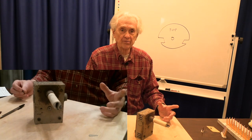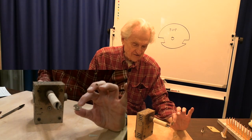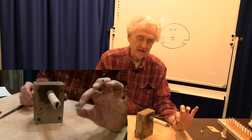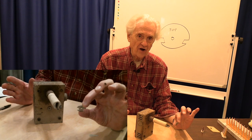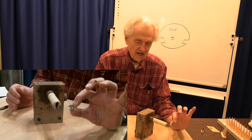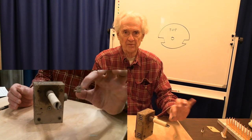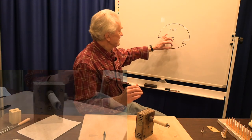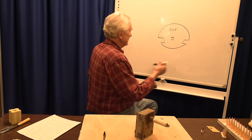Or I can also use a gauge, which is supplied when you buy a new electric kiln — it comes with a little gauge that looks like this. In most cases when the kiln sitter is shipped, this gauge comes shipped on the kiln sitter. This is only for manual kilns; kiln sitters aren't even provided on electronically controlled or programmable kilns. Most people think it's just a shipping stop and throw it away, but it's actually a calibration gauge.